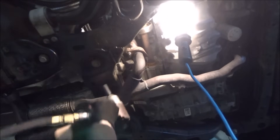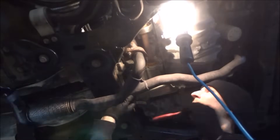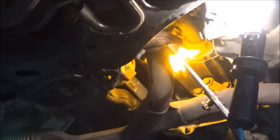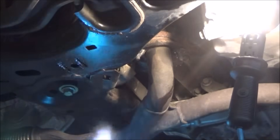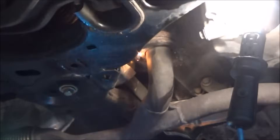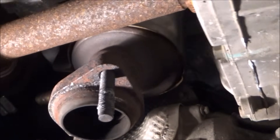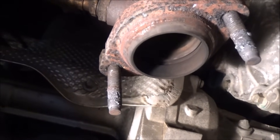When I first looked at these two I knew it wasn't going to go well. These are normally 15mm nuts but they're rusted down to maybe a 13.5 — looks like someone tried taking them out before. So there was no option but to cut them off. Run a thread chaser around those studs and these things will be good as new.